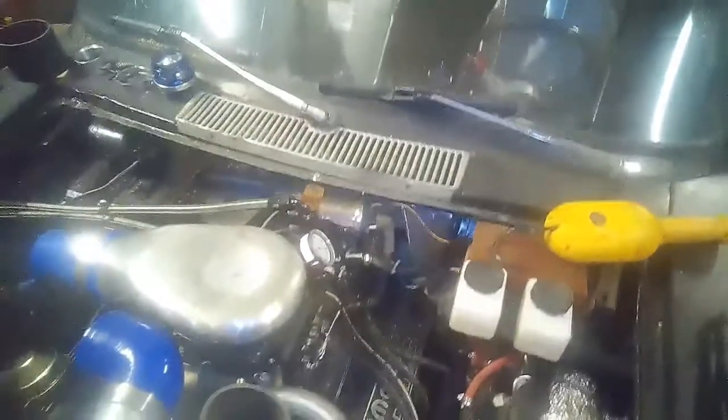I'm using the flying crank trigger, which you can see down here, and I've had to modify it in order to line up the pickup with the flying portion itself. But we're wired in, and I've made the modifications to the wiring harness so that ideally it should fire up for us. But we'll see. Hopefully none of my tools get rattled off into anything important.